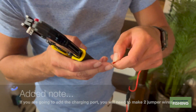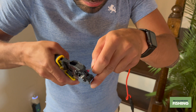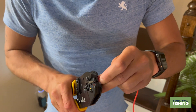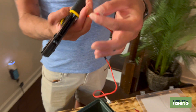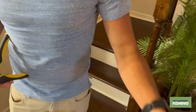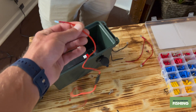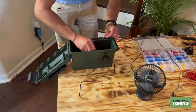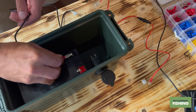Bryce has trimmed back the wire and is adding a female end connector – something we've had laying around from other DIY projects, very cheap on Amazon. Bryce has a nice set of crimpers, which make life easier, though you don't strictly need them. He crimps each connection twice for reliability. That's really all you need for the $40 setup. He'll do the same with the black wire. For the optional switch and charging receptacle, you'll need a few more connectors.